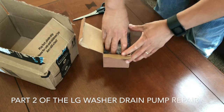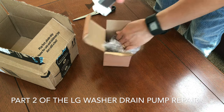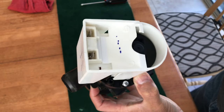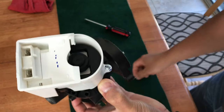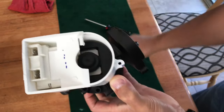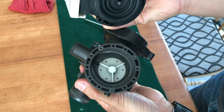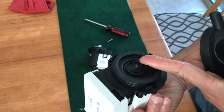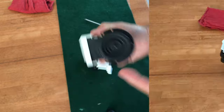This is for the washing machine — our laundry is building up so I'll get installing. Hang tight. I'll separate the drain pump from the pump housing. I loosened it up already. There's your problem: a metal rod right there broke off, and that's the reason why it's no longer working.